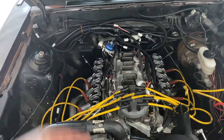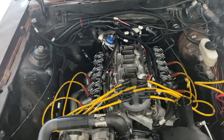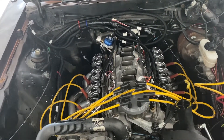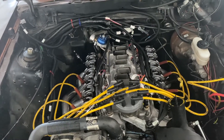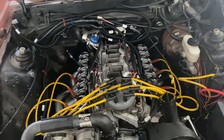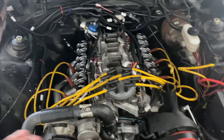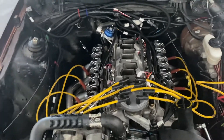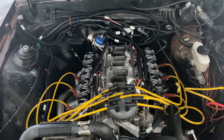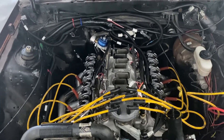The intake valve on the number four cylinder was really, really loose for some reason. Like I said, I've been hearing a little bit of noise — it wasn't really excessively loose, it was just backed off a little, probably from the initial adjustment. That's why I wanted to go ahead and get back into it and make sure all the adjustments were right. The rest of it wasn't too bad — maybe a smidge tighter now, but all in all it was fine, with the exception of that number four cylinder intake. So I'm gonna get the top end put back together and then we'll start it up and see how it is.